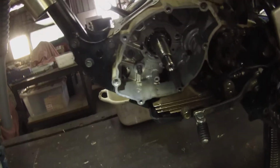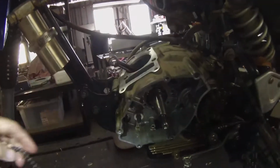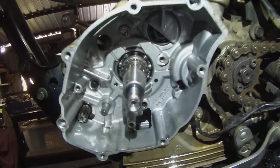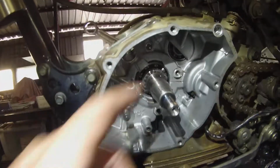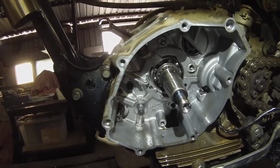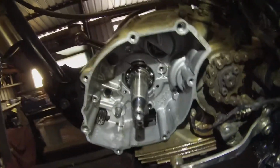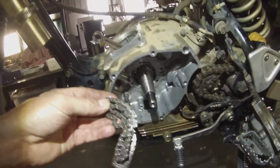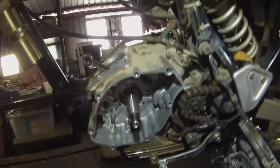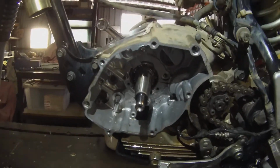So anyway, one of the other mistakes I made was I gave it a turn. I spun it quite quickly while the timing chain was in there, trying to keep it off the sprocket the whole time, so I'd give it a spin, and everything was spinning beautiful and smooth, no vibrations. But then all of a sudden the chain got caught on the sprocket, it locked up, came around, took a chunk out of this and jammed solid. Although there's no real damage done, I will deburr that. The problem was I should never have spun it with this on there. I should have been a lot more careful. So I had to take this flywheel off. I had no choice. Anyway, it came off, but man, that came off with a loud bang.